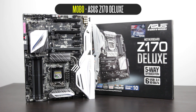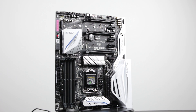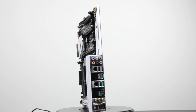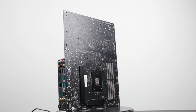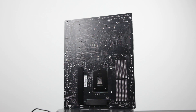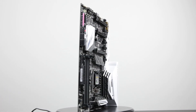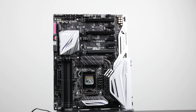In terms of our motherboard, we're using the ASUS Z170 Deluxe. This board supports socket 1151 for the new 6th generation Intel CPUs. Some of the awesome features include full support for M.2 at 4x speeds, 6 gigabit SATA connections for plenty of SSD speed, as well as two PCIe 3.0/2.0 16x expansion slots so you can fit pretty much any graphics card. Additionally, you have plenty of USB 3.0 connections as well as one USB Type-C connection — that new reversible USB connector. I think this board is going to be pretty future-proof for the next couple of years.